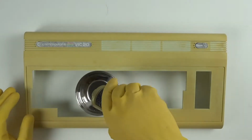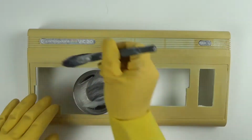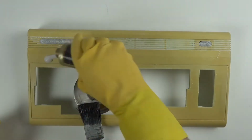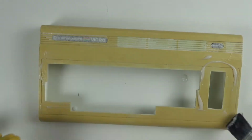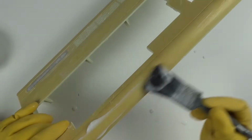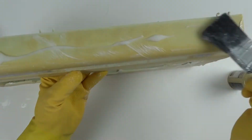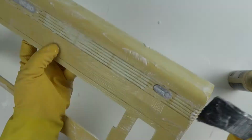I use peroxide cream and a UV box as it's now autumn in the UK and yeah, the sun ain't coming back until next year. I put some cream on the brush and cover the keyboard. Usually I do this in a pot, but instead I thought to try pouring the cream straight on the case just to see if it helps with the distribution.